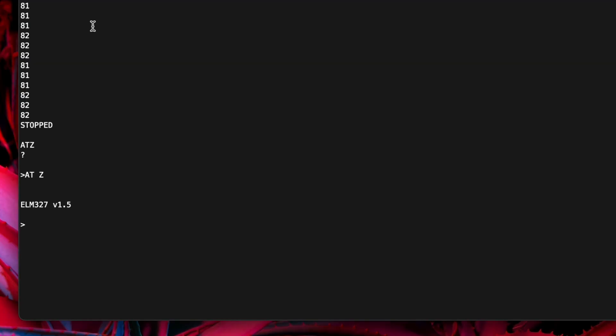Next, you're going to want to ensure that the ELM327 is showing you its headers. By default it doesn't — it only shows you what's in the data portion of the KWP packet. This just won't do. You need the headers and the checksum that are essential to an OBD2 packet. With the command AT H1, that will enable headers, and you should see an OK after this command.